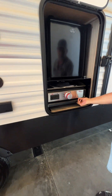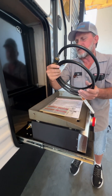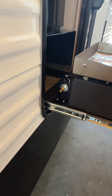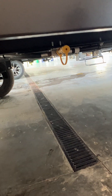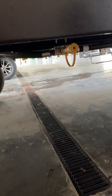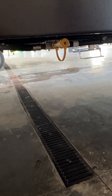The outside grill pulls loose down here at the back. It does have a quick disconnect hose that hooks to the connection here in the back and the connection on the frame down under. When it hooks to the connection down under, it has a T-handle on the top that has to be turned in line with the hose for gas to come from the propane bottles up front to the outside grill.